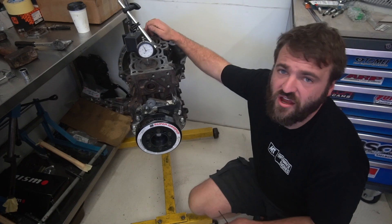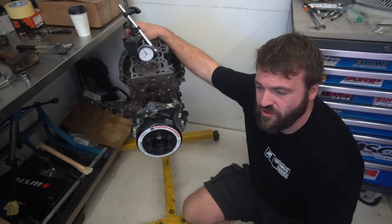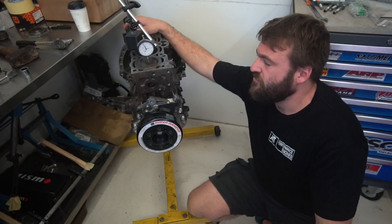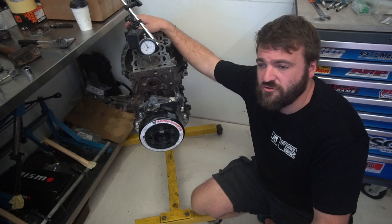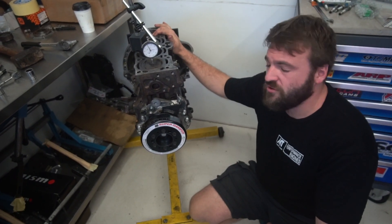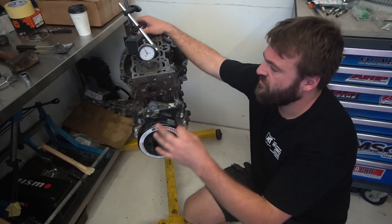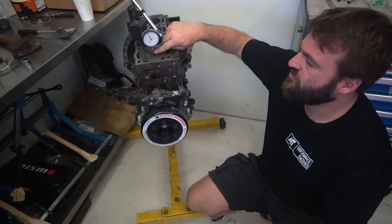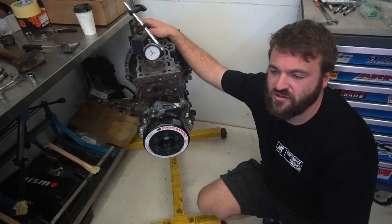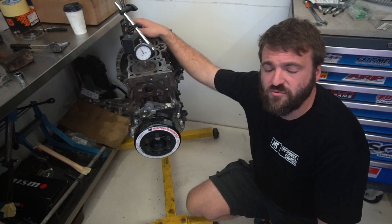If there was an error and it was two degrees out — two degrees before top dead center or two degrees after top dead center — this crankshaft would now have to be programmed into the Haltech, or Motec, or Emtron, or whatever ECU you desire. You would program in that two degrees of incorrection, so that when you do put 10 or 20 degrees of timing in the engine, it holds 20 and not 22 or 18 on that cylinder, because we're basing everything off number one, not number four. So now we want to index the crankshaft — and this is something we can do in the vehicle. Once we put the balancer on, we can index with the dial gauge. Obviously we'll have a cylinder head in place, so we'll need a longer rod, reach down, and find that piston. We're going to index that engine and program this into the Haltech Elite 1500 in this case, so we have perfect timing come dyno time and can extract every single bit of power out of the engine.